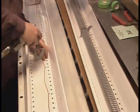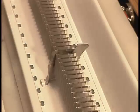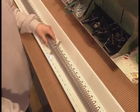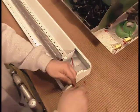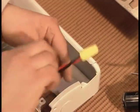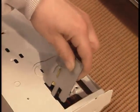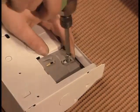Now they install supports to hold the heating element in place. They're made of satin-coat steel, a rust-resistant metal. As the element heats up, it naturally expands. To prevent it from scratching against the metal casing and making annoying noises, they install a heat-resistant plastic bushing. Now they connect the red wire that'll carry the electrical current to the heating element's black wire, capping it with a wire connector. They clip it to the cover of the junction box, easy access for the electrician installing the baseboard. Then they close the junction box cover.